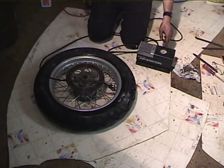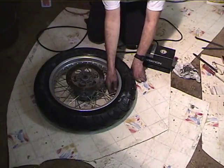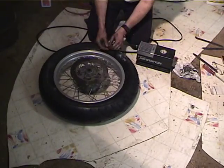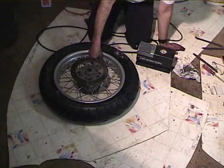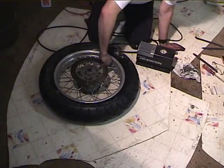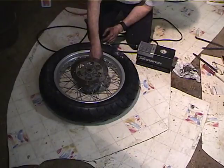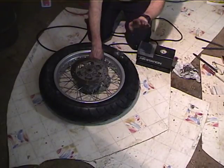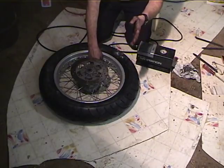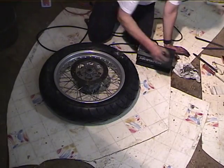Anyway, I run it up to 50 pounds, which is not where I'm going to run the tire, and I tighten the nut up. I'm going to take the valve stem back out, completely let all the air out of the tube so that the tube can settle, and then I inflate it to the final pressure. Okay, so now with the tube totally deflated, it totally relaxes. The bead is still seated all the way around the tire, so now when the tube is inflated, it will inflate evenly and no place on the tube will be strained. So I don't think you want to hear this thing inflate again, so now we're going to...